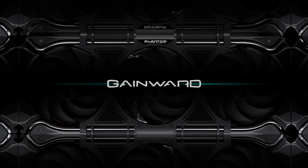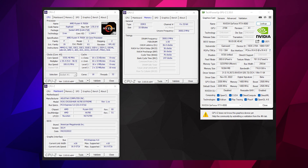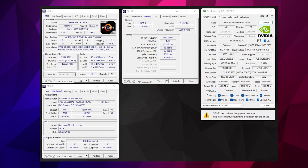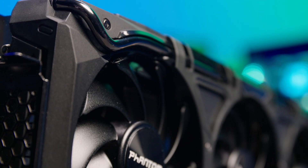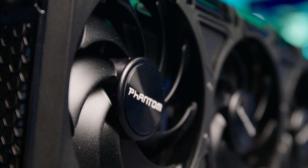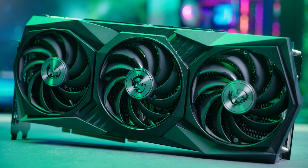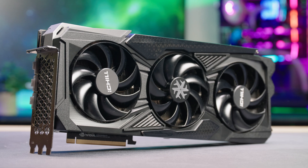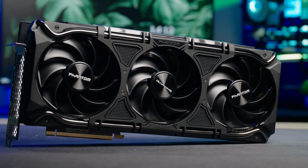So how did we test the 4080? We tested it in exactly the same system as we used for the 4090 — see the video in the description below. It was an ASUS Gene motherboard with a 7950X boosting up to around 6GHz maximum, 6000MHz DDR5 memory, and a really fast NVMe drive, just to remove as many bottlenecks as possible from the CPU and stress the GPU, especially when doing 4K benchmarking. We compared it to a 3080 Ti Strix, an MSI 3090, the iChill 4090, and the Gainward Phantom 4080.